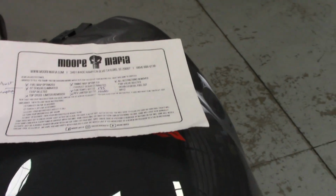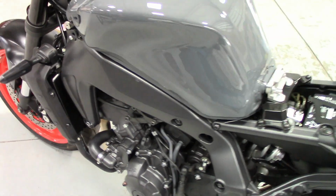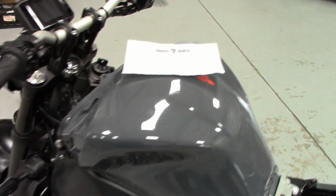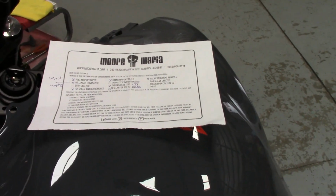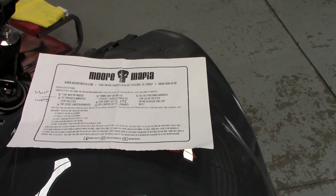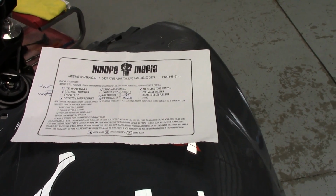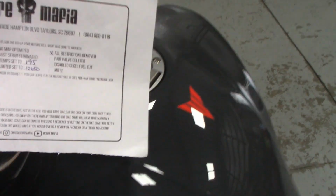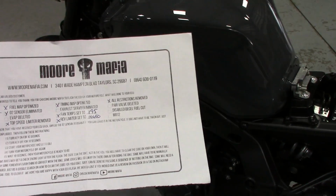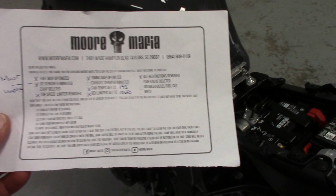So that means the secondary throttle blades, I call them secondary butterflies, are being opened. I was talking about it, and I believe first gear is the only one where they're ramped in, because it would either bog if you nailed it super hard with them out. Yeah, I don't know about that, though. But it's going to do something funny, or it's going to have too much power, and you just won't keep the front end on the ground. So I think he progressively brings those in, but much sooner than stock, then they're fully open, 100%. Then I believe all the other gears are all 100%.